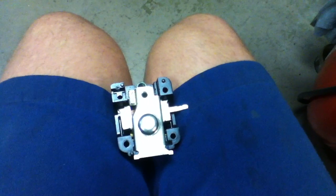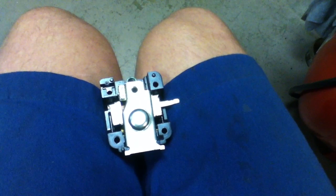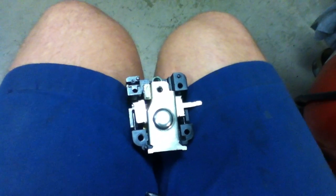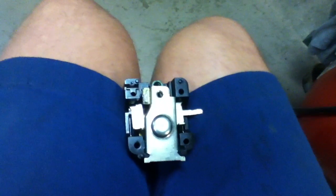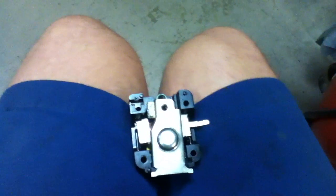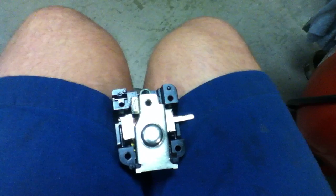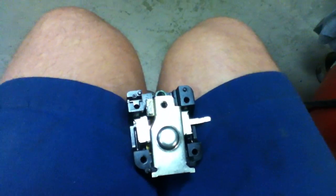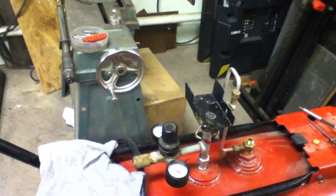I might post more videos once I find out what's wrong with the motor. I took the capacitor assembly off the back along with the little overload, and I think the 400 microfarad capacitor is bad — not sure if that's the run or start, but it's probably the start. My capacitor meter isn't reading nearly high enough. It's labeled capital MFD — that would technically be megafarad, but a megafarad capacitor would be huge, so it must be a capital M for micro rather than a small m which would be milli. But good luck with this. If you've never decided to take your pressure switch apart, I'll post the part numbers and model number of this compressor.